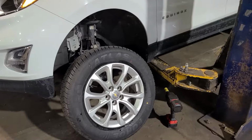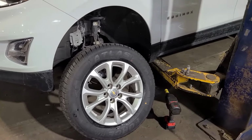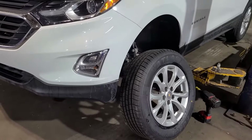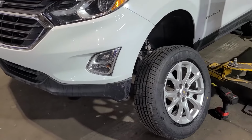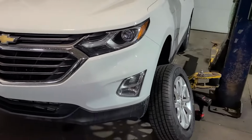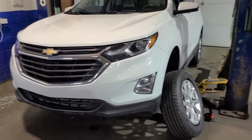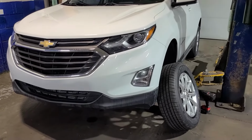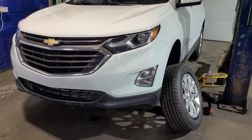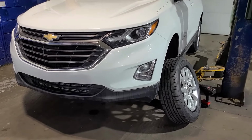So remember, before you do any type of TPMS work, always check all your sensors first. This is very, very important on Ford vehicles, because I do a lot of Ford trucks with transmissions and BCMs and PCMs, a lot of Super Duties, where after you update the PCM or BCM or TCM, or if you got to program keys, they want you to relearn the tires too. And if you're not able to do that, you could get a tire message to where you didn't have one before. So just remember to be very mindful of that.